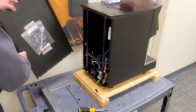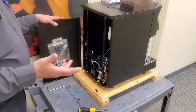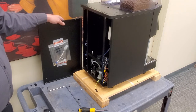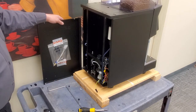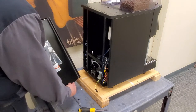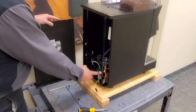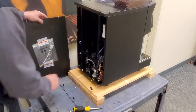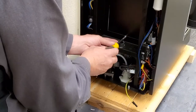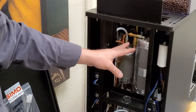There's no rhyme or reason when they go out — I've had some last only eight months and others last years. Yes, I would replace the thermal fuse every time you do a preventative maintenance when you're in the back of the machine — tip of the week. The bottom of the back panel has two holes which go up onto two pegs. Here you have your mains valve and your incoming water supply, and there's your flow meter. To access your boilers there are two screws — the bottom one you just loosen and the top one you remove — giving you partial access to your boilers.